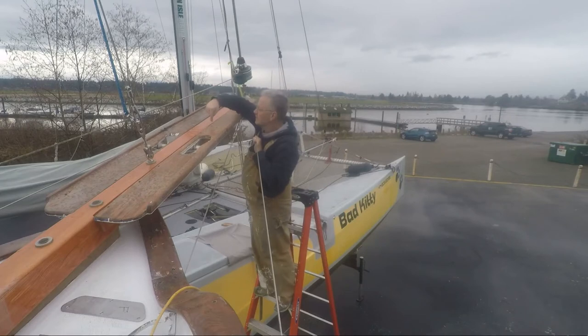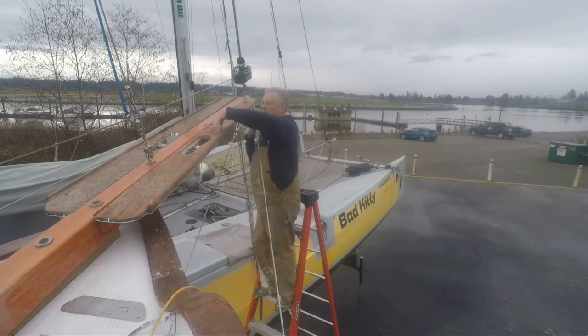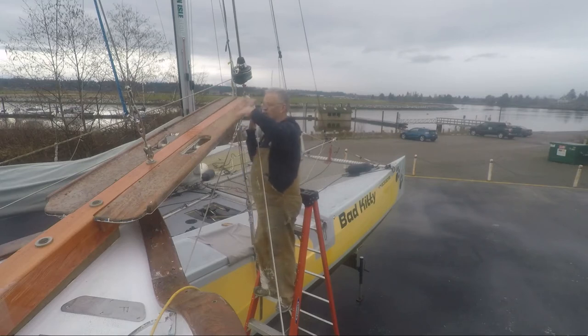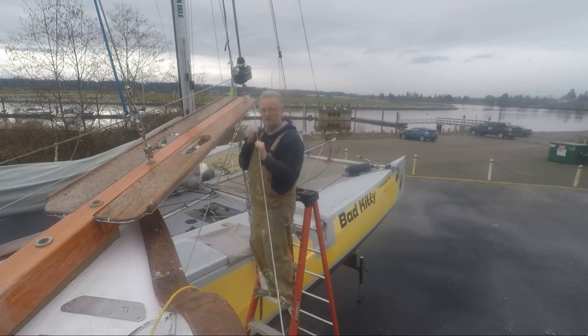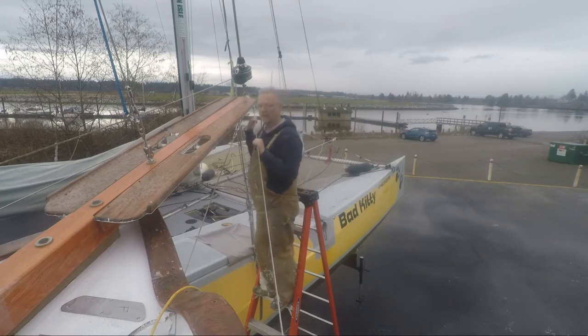Now when I fasten this in, the fasteners get screws all the way down the inside, and there's two wood plates, and I've added steel across here and across here. Now the steel plates will make the platform level. Putting the screws in will make it follow the ledge. So I think what I'm going to do is, when I mount the thing with screws, I'm going to have to put a little bit of thickened epoxy on top of the bracket and let it fill the gap. While it's wet, it'll make a perfect fit. But other than that, I'm really happy.